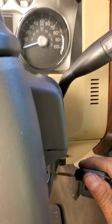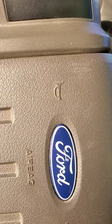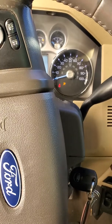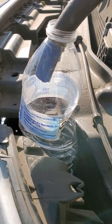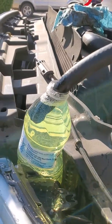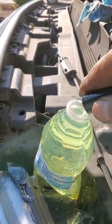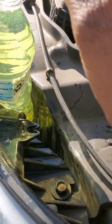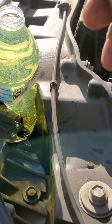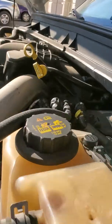I come into the cab and turn the key. The fuel is not coming yet — there you go. So I needed a bigger bottle — I spilled a little fuel here, I can wash that up. Once the diesel starts coming, that means you are clearing the air from the line.